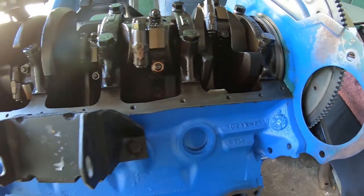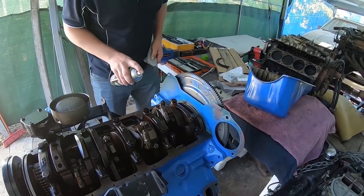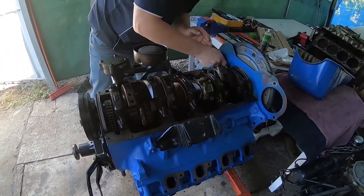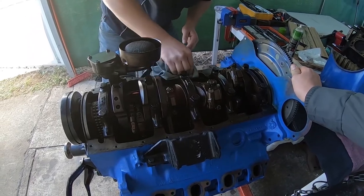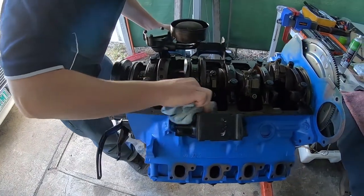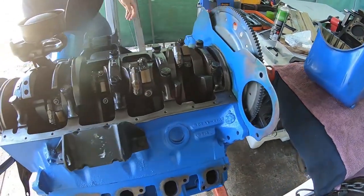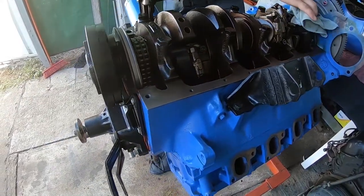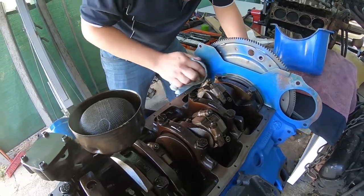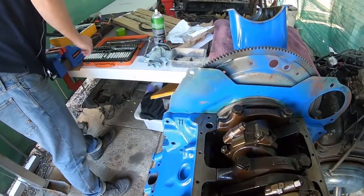I get a can of wax and grease remover and a microfibre rag so it doesn't leave any dust, and give it a quick spray. Wipe the rails — you'll leave that sitting to penetrate into the crevice for a minute. Nice clean steel. Wipe the back channel.